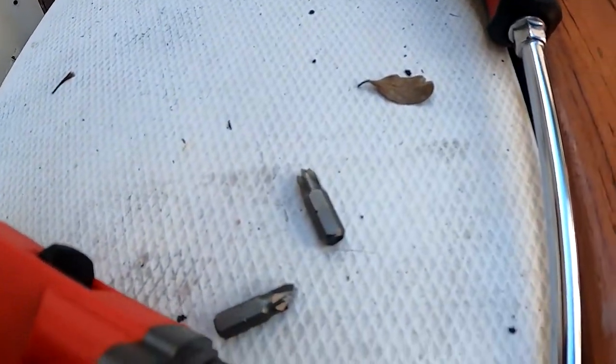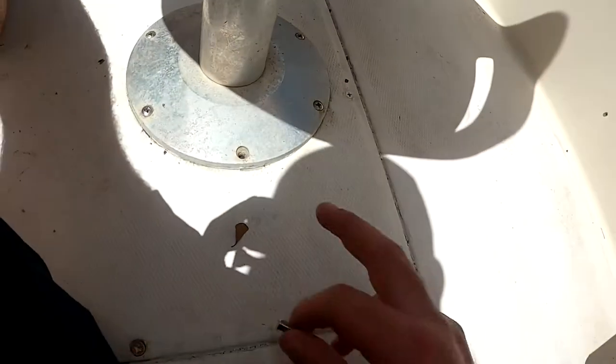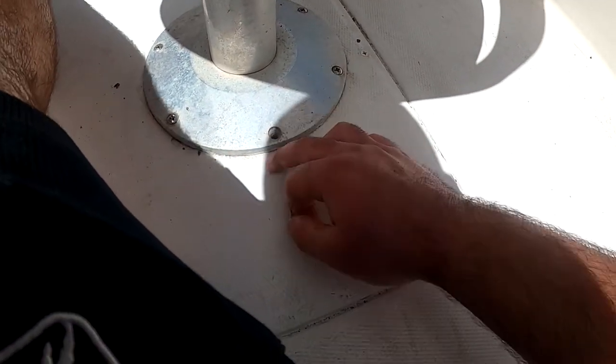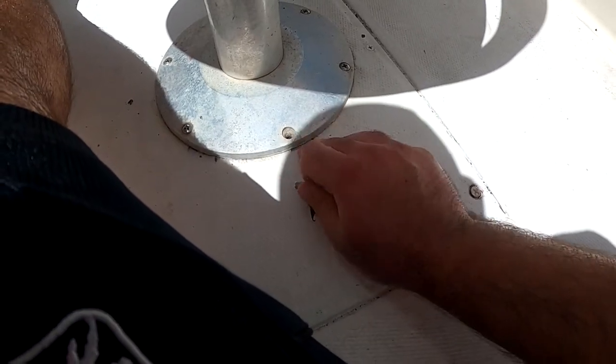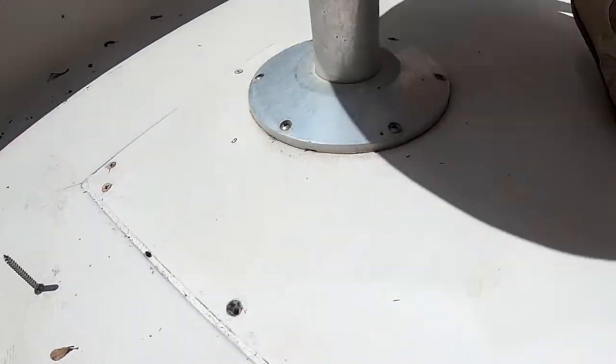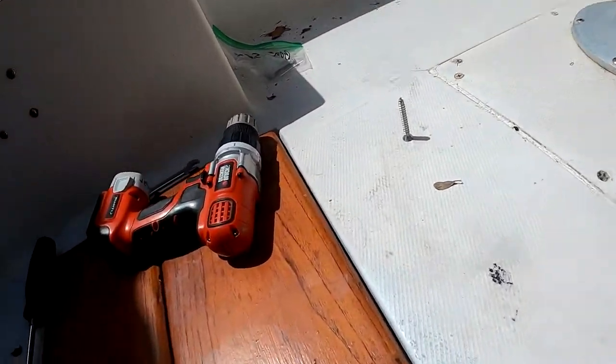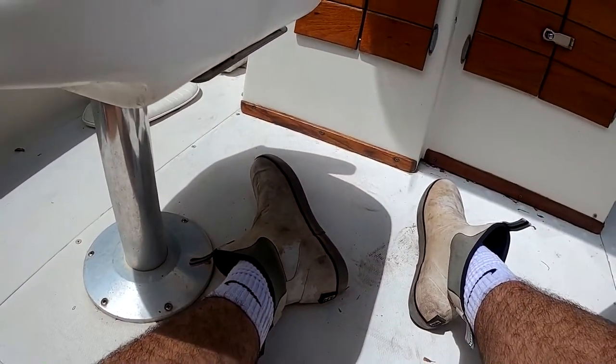Well, I already broke through two drill bits. I was only able to get one screw up from the chairs, so I got some stuff at this store. It's called D-Bond. It'll break through the 5200 that's holding the chairs to the deck, but funny enough, I got one screw already up easily from the floor. So we're just gonna go ahead and take the console up, take the floor up, worry about the chairs later, because that's gonna be a pain. But let's get this console up, boys.